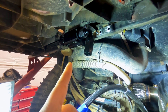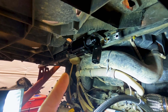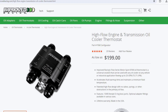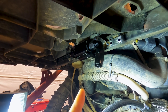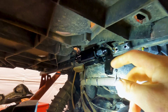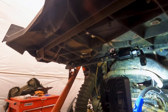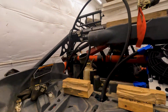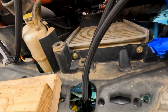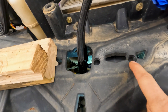Got the oil cooler thermostat in. You don't want to run just an oil cooler without a thermostat because the oil can actually get too cold. This is a 205-degree thermostat — it starts to open at 190 and is fully open at 205. Mounted that up there; I still need one more 90-degree fitting. Also had to drill two holes to access the fasteners holding the thermostat on.